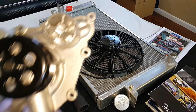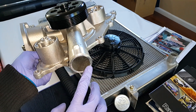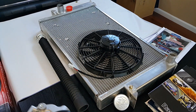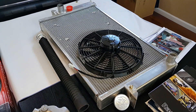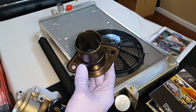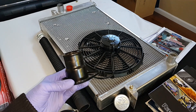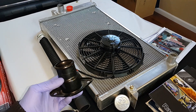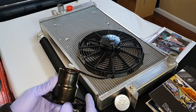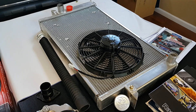What we're also going to do — this is a spare water pump for the CUDA — we're going to weld an AN-20 bung right here so it matches up to the radiator. We're also going to weld an AN bung to our water neck. This is a steel OEM piece, but we're actually going to run an aluminum water neck from Billet Technologies. That's with Prefix right now because they're currently building the 426 all-aluminum Hemi for the 73 Challenger. When we get that water neck, we're going to weld in a dash-20 AN fitting, so there should be no leaks with that setup.